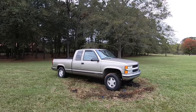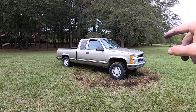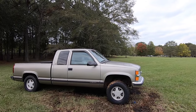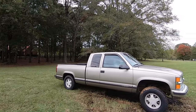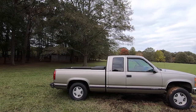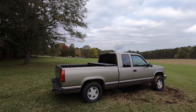There she is! Hopefully the install video was adequate for y'all to know what you're getting into. She is squatting a pretty good bit. I did measure it and it came out to 36 and a half inches up front, so we gained a little bit over four inches of lift on this thing — that's absolutely sick. Yeah, it's so far so good — freaking sick. I'm gonna go take it for its first drive, probably do that in a different video. I know not everyone's going to love the squat, so we're going to raise the rear end up some. We'll at least take the drop shackles out in the rear and that should bring it up quite a bit.